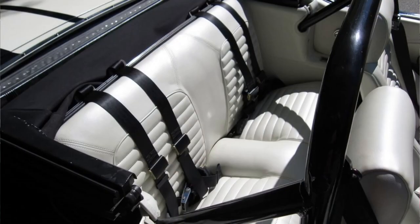Now, the problem with that, other than cutting holes in your inner quarter panel, is that it actually pulls down on your shoulder. That is not good, but it's definitely better than nothing, or better than just a lap belt, in the event of a serious collision. One of the things to consider is the convertibles — that's pretty much the only option you have, other than putting in a roll bar or a harness bar going across.